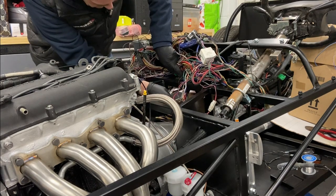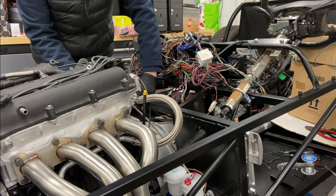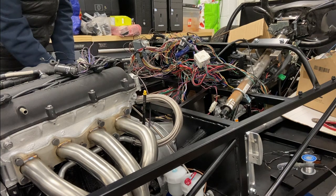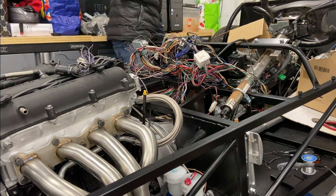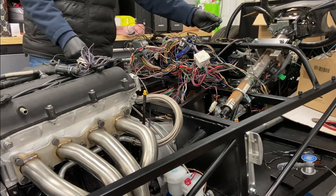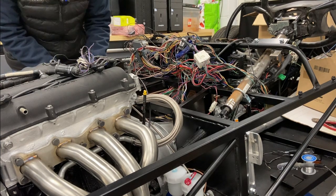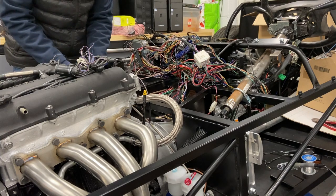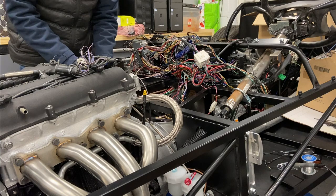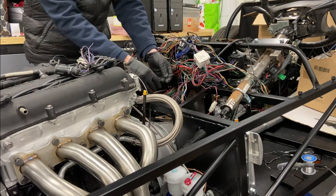I need to make sure I've got everything — I'm missing one which is in this little loom here. That just needs a little bit of split conduit. See, started to make a loom there — that's the wiper motor, so I'm gonna put that in there. Some bits of the loom are gonna need to be extended. I want to put a big fat earth all the way down to the front and then earth everything from that. I'll run an earth block up here and that will go down to the front — earth everything in one place.